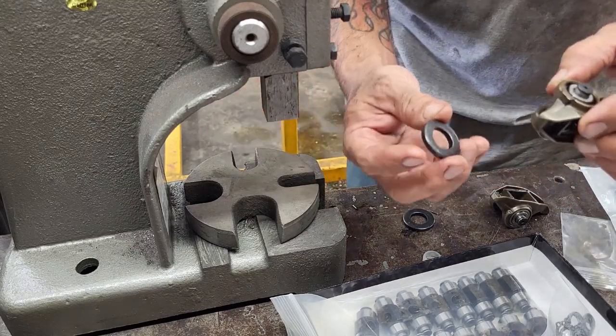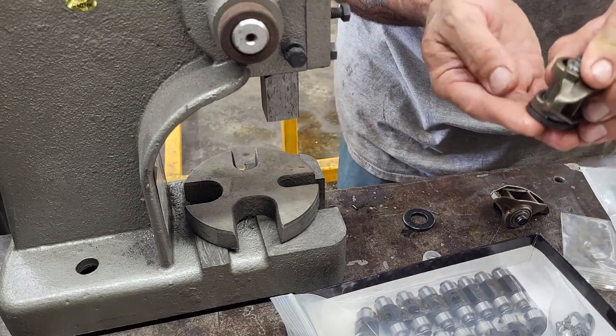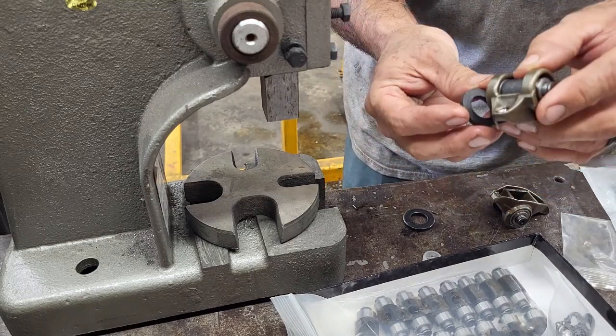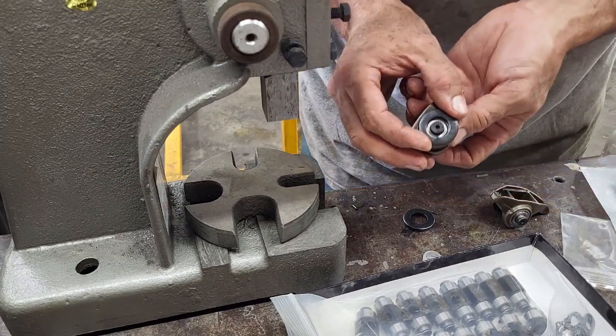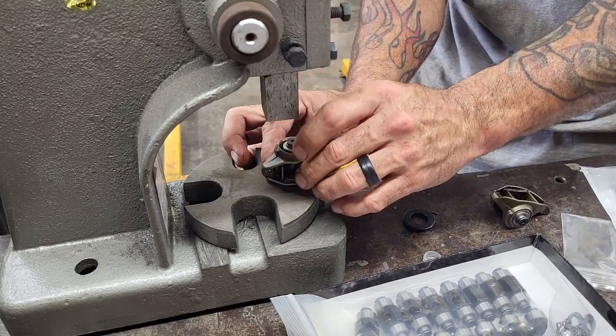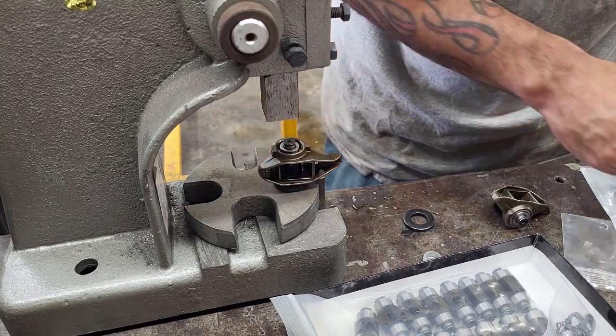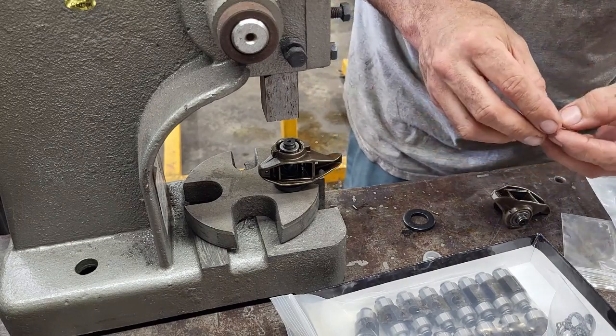So it comes with these installation washers. What that does is it adds a gap so you can push this down with the press, and it'll push evenly on the surface of the bearing over there. So you can see that it doesn't touch the trunnion at all. So anyway, put that across like this. Take your new bearing, which I'm not prepared for, but here it is. Go ahead and push the plastic piece out.